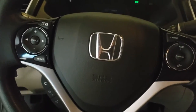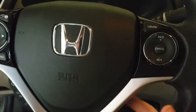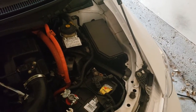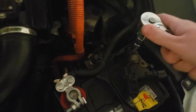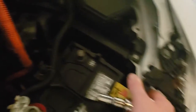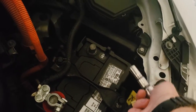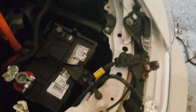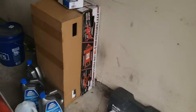To get the clock spring out, we need to take the steering wheel off, and we do need to take the airbag out. So the first thing we need to do is pop the hood and wait for the automatic headlights to turn completely off. Once your lights are off — which indicates your entire system is off — go ahead and remove the negative battery cable. It's just a regular 10mm, same place regardless of which trim you have. It is recommended that you wait 10–15 minutes before touching the airbag so the capacitors can discharge.